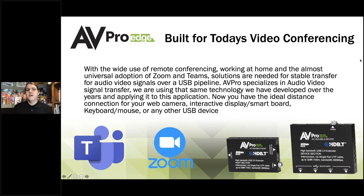You can place this unit in line where that USB cable would go, and now you get a few other benefits — you can connect up to four devices on the end. This host connects to any computer that has a USB outlet. It does support USB 2.0, so you'll definitely want at least 2.0. Teams, Zoom, and GoTo take up a lot of information — we compact that data into packets, send it down the line, decode it, and play it to our screen with as little latency as possible.